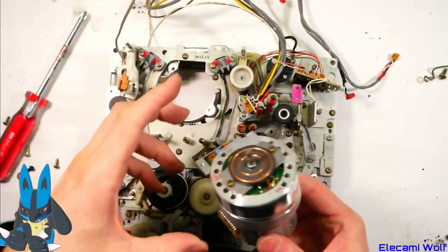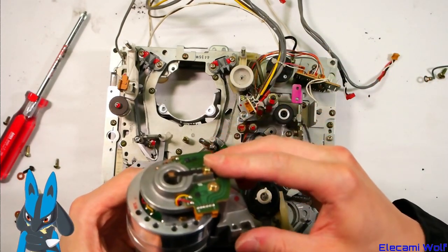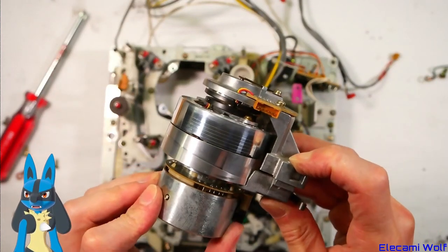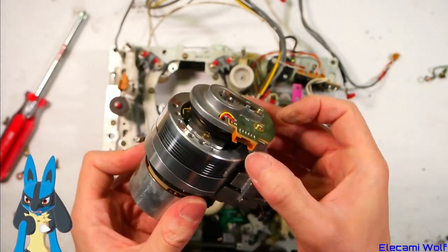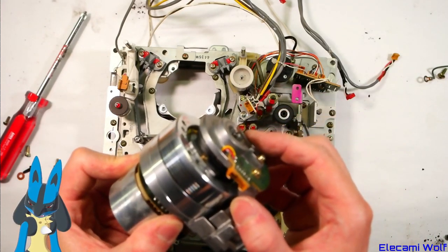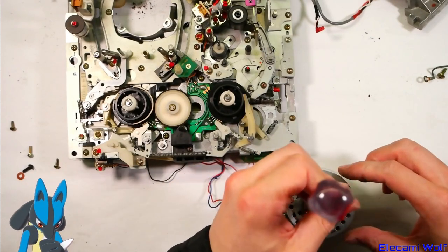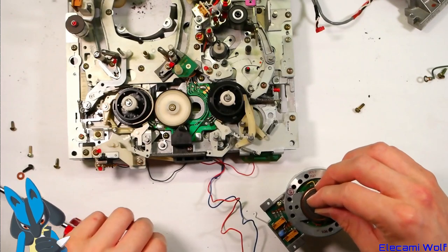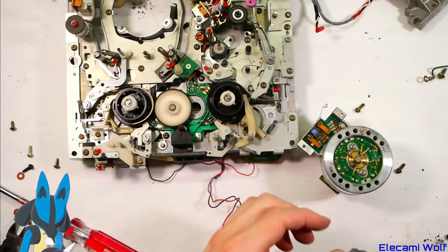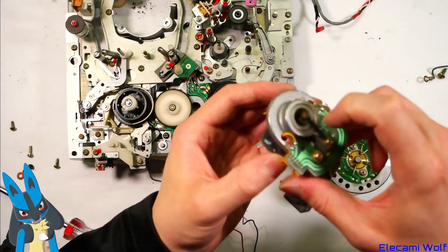The NV850, which we haven't got to yet and we're going to do a video on, pretty sure that also has top pickup as well. So maybe that was an improved thing they did for a while. You can actually see the high-frequency transformer that couples the signal sitting there almost touching each other. The shaft comes with it. So it's just a regular video head under that — that top piece is just an add-on that brings that transformer and the little grounding post.